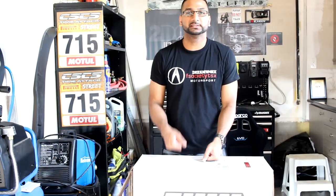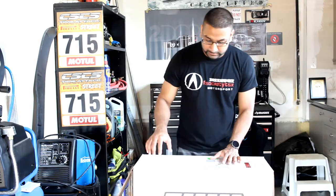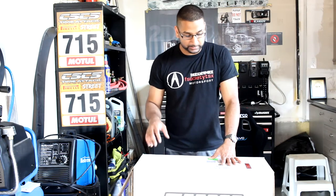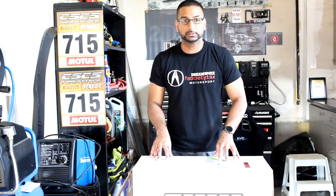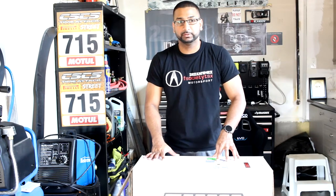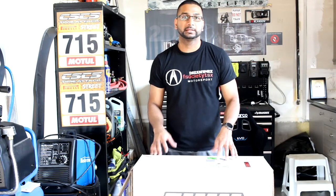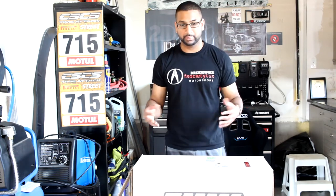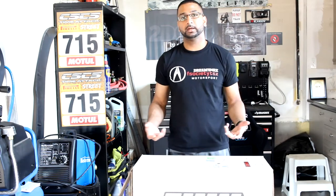In 2019 my engine decided to blow, and I think the reason was oil starvation. This Moroso oil pan, with the RSX pickup and RSX oil pump, is hopefully going to help with that. It comes with a trap and baffles to keep the oil closer to the pickup. Last year on the track there were turns where I could see the oil light blinking, and that was probably the issue when the engine blew — it happened on the same day.